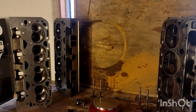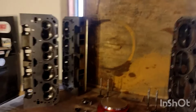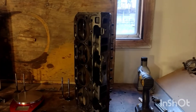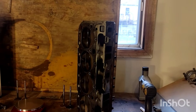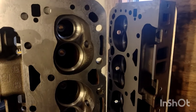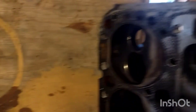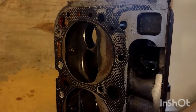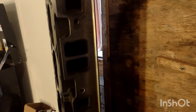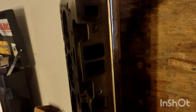With that in mind, a lot of people have switched — myself included — to running these stock replacement heads. On this side we've got the Dart cylinder head that we're allowed to run, and on this side we've got the EQ cylinder head, and they have some things that are similar but some things that are different. Starting off looking at the combustion chamber, the Dart heads have a really nice heart-shaped combustion chamber that makes for a more efficient burn of the fuel and helps make more power, whereas the EQ heads have more of a bathtub-shaped combustion chamber more typical of the smog era heads. So in order to balance that out and keep things competitive, the ports on the Dart are quite a bit smaller compared to the ports on the EQ.